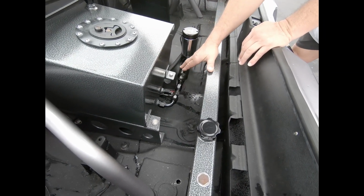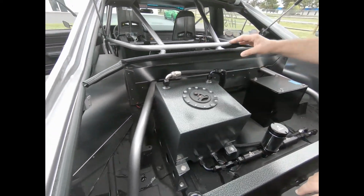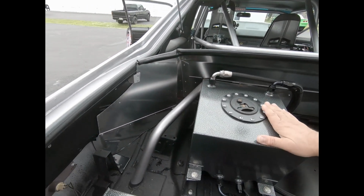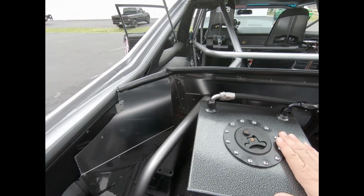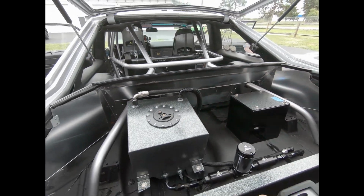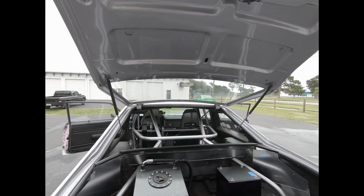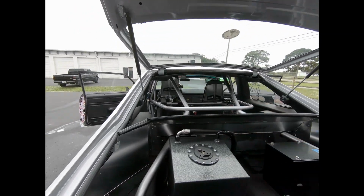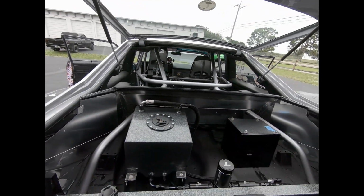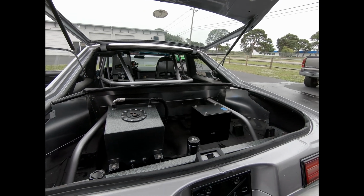Brand new fuel system we put in the car, and then we had this made, custom built. Anything that's the fuel system cannot be in the driver compartment. So this is all built to where it's completely sealed. So if there is a crash, when the hatchback comes down, this rubber seals it. So it's sealed. Fuel cannot get in the car. In its own little area. Yep.